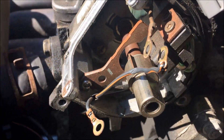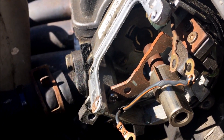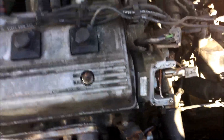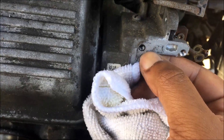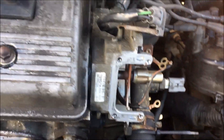Just an FYI: if you look inside your distributor and you see oil, you probably need a new seal — or these days it may be easier to replace the whole distributor. When you put this back on it's basically the reverse of everything. Make sure the surface is clean — there's some pasty glue-like inhibitor on there. Just wipe it down; you could probably scratch it off with your nail, but if it looks decent like this, don't worry about it.